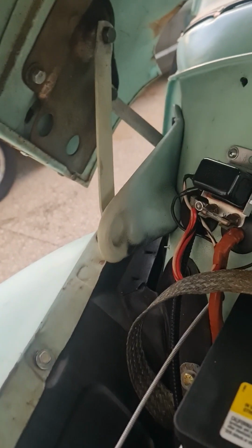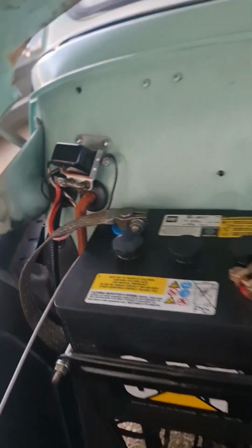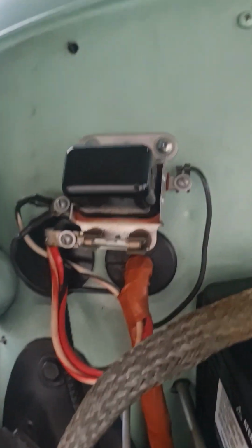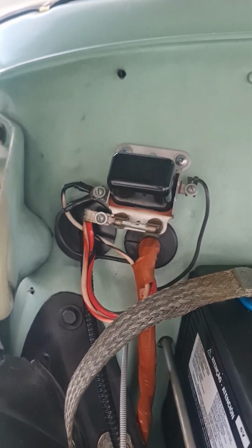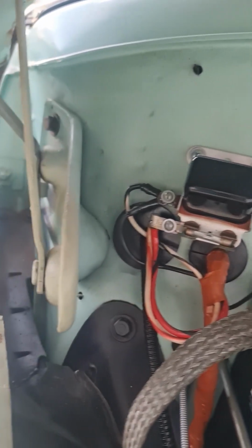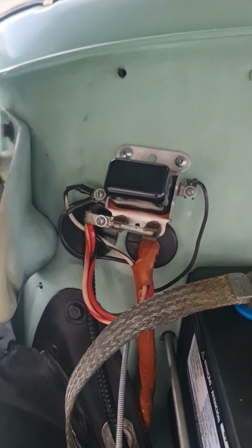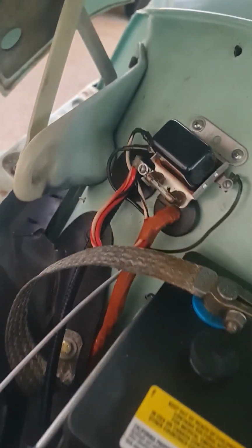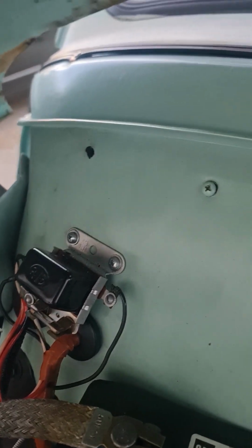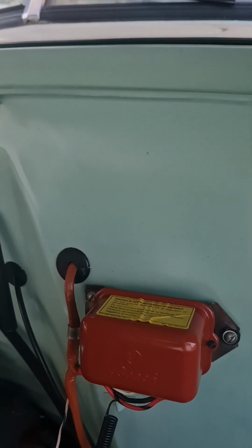And because the FJ panel van and the FJ utilities were built on the same assembly line, when they ran out of the cloth wiring harnesses, the cotton covered cloth, they could use the wiring harnesses that were PVC, and they've adopted the same colours that are in the workshop manual for the wiring diagram. So the wiring harness goes inside at this point into the cabin, behind the regulator box here.